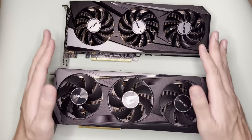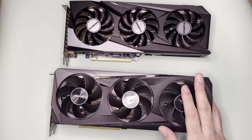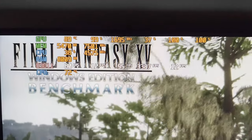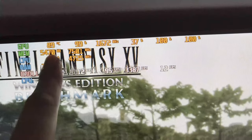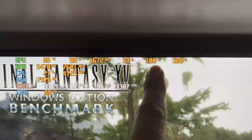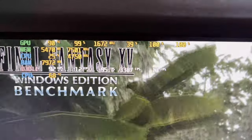Just to let you know, when these two cards were brand new, the Aorus Elite constantly outperformed my Gaming OC by 2 FPS. I also noticed that the fans in my Aorus Elite were at 100%. Looking back at the footage, notice also that the temps are very high at 90 degrees Celsius — this is unusual in almost every GPU.